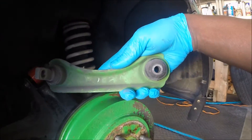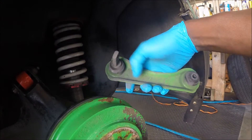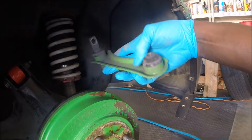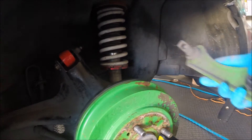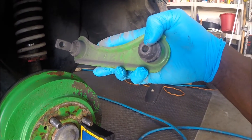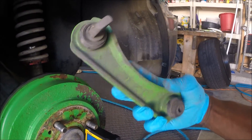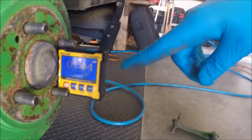When this one is off the vehicle, I put it close to this one and try to measure it — even though it has a curve. I put it as close as possible and line up the holes. Since mine was cambered a little bit, I made sure it passed the hole just a little bit in front so that when it sits down it will rest back a little, but not give it as much camber as the old one did. The old one is stock so it couldn't move, and that's how the rubber got destroyed.